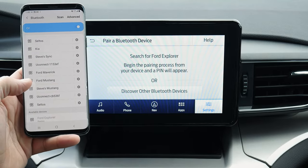There are a series of general settings: do you want English, Spanish, or French; Celsius or Fahrenheit; kilometers and liters per 100 km, or miles per gallon. The beeping — if that drives you nuts, you can toggle it off. And then reset: Ford Pass is an app on your phone you can use to remote start your vehicle and a few other things — if it's giving you problems, you can do a reset there. And if you're selling your Explorer, just do a master reset to bring it back to the factory default.